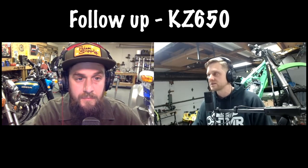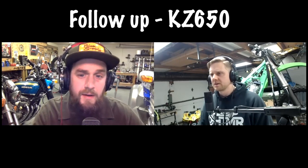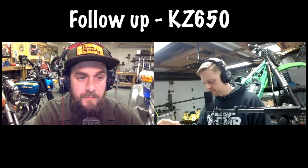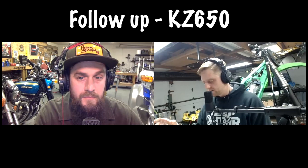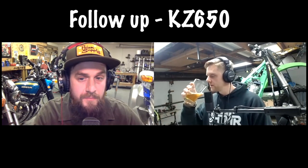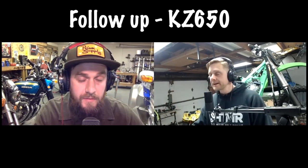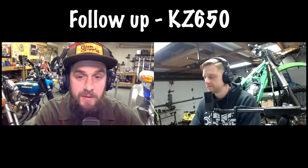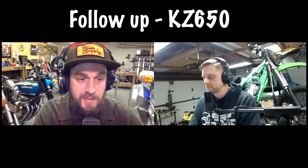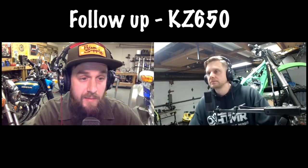And then with the mains, you and I always say 15 to 20 larger. Is it 15 to 20? Yeah. So if it's 115, go to... I would start at 125 and work your way up. Yeah, sounds good. You're going to be messing with it. There's no surefire jet size but you'll figure out what you're going to land on. If you're dealing with mid-range stumble or no go after full throttle, then you got to keep going up.